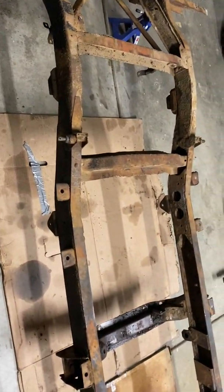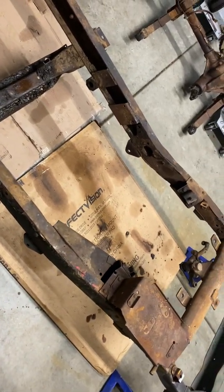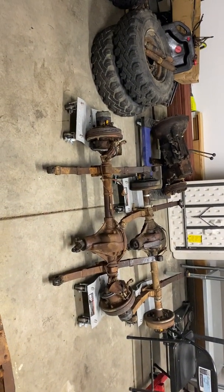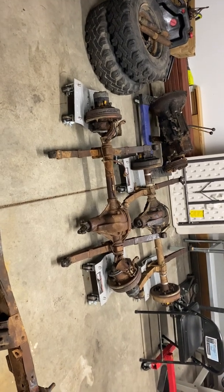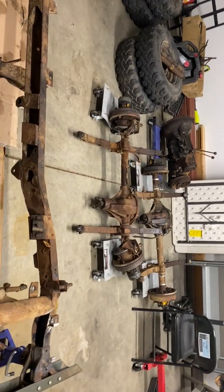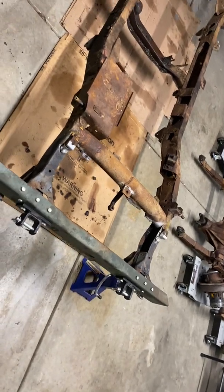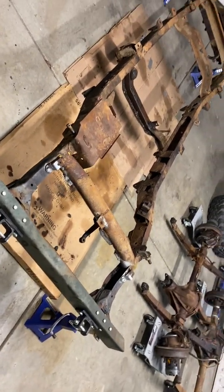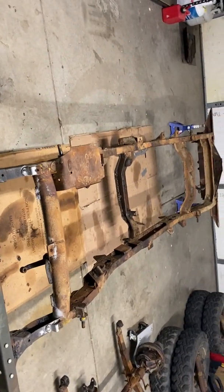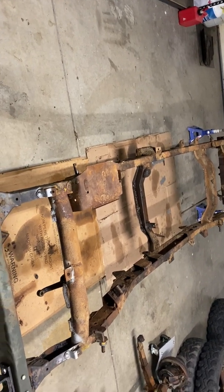And then of course the leaf spring came right down. And then the front rotating bolts, they're real easy, just 3/4 with the bolt on it and a greaser. They came right out. I've got the leaf spring still attached for that reason to the differentials front and rear. Those came out really easy, you know, if you have 4 floor jacks, it makes it real easy. 2 under the pumpkin, or the cross axles, and then 2 on the frame. And then as you remove the leaf spring brackets, you just lower it down on the jack,